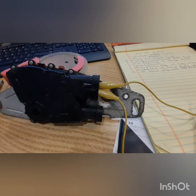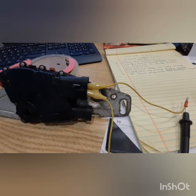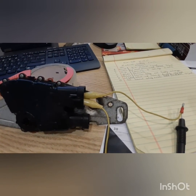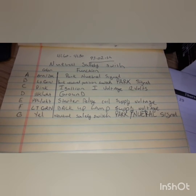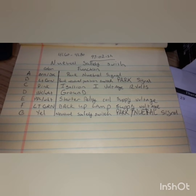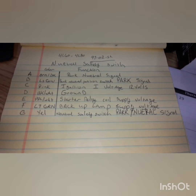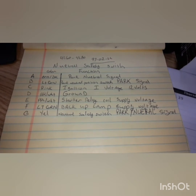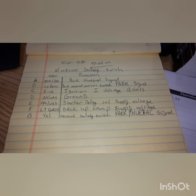The first thing I'm going to show you is how to turn on your reverse lamps. You will want to send 12 volts to pin C via a fused connection that comes from the ignition switch. You're going to want to connect pin F to your backup reverse light wire. Chances are if you've already had an automatic or even a manual transmission you're going to have the wire right there, otherwise you can run this to your reverse lamp circuit. The power is going to come in from pin C and when you put it in reverse it's going to go out through pin F.